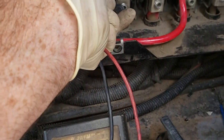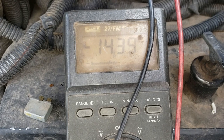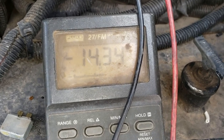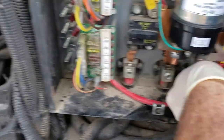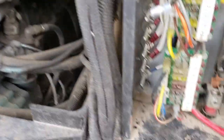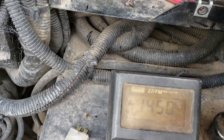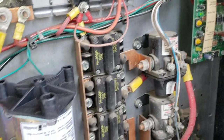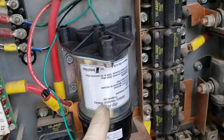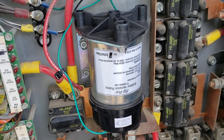We're just plugged in right now. We have 14.4 volts on the engine battery. It shouldn't have to go to the house at this point because the engine's not running — pretty obvious. We're reading 14.4 to 14.5, so it's doing its job now. And if we were to disconnect power, it'll still energize for about another 5 to 10 minutes, then it'll finally drop out — you'll hear it clonk out.